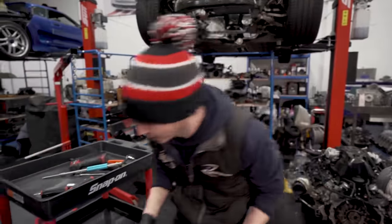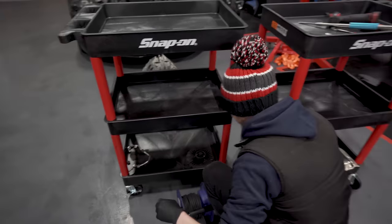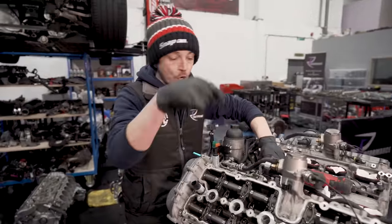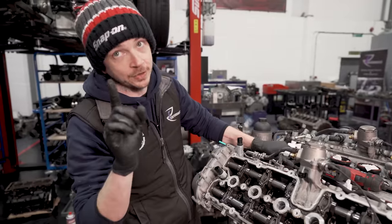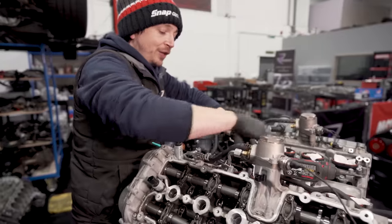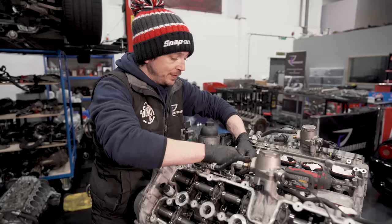Right, that is left head, so that is down here. That is a bad day at the office. They were lucky because they hooked it out. They pushed the valves open and then used a tool. They're stainless as well, so not magnetic. He was messaging me going, how do you think I'm going to get this out? I'm like, mate, if you can't get that out of the port, that's head off.